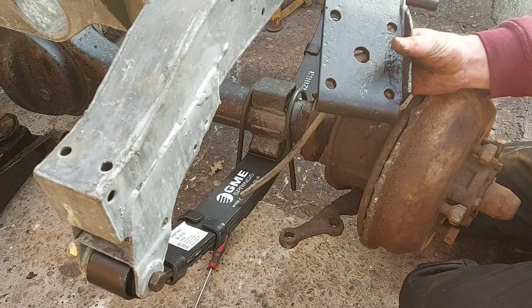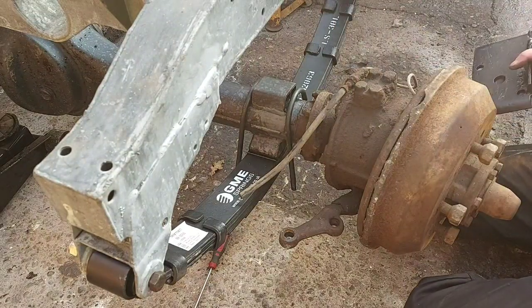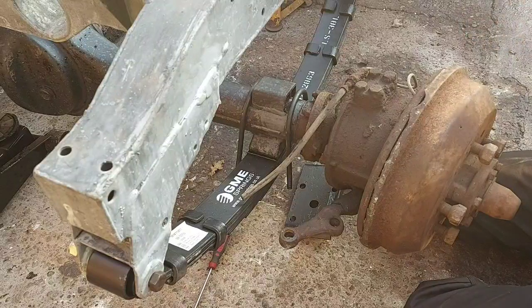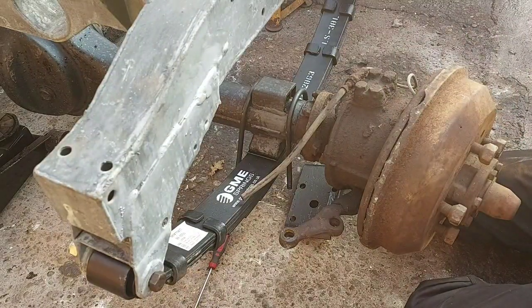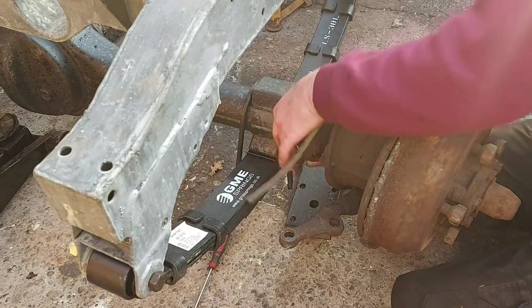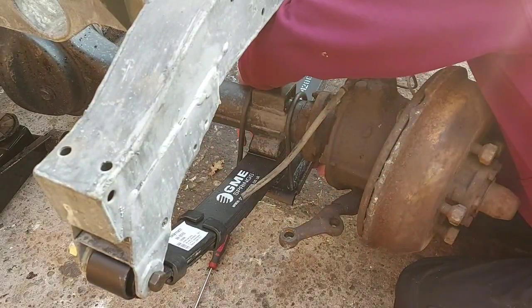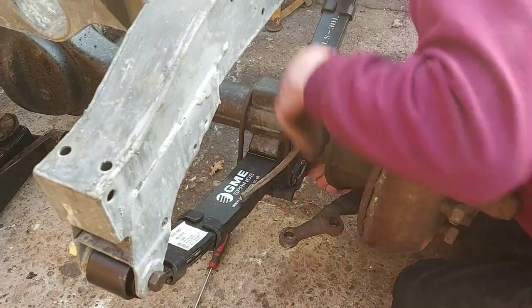Right, don't know if I mentioned it earlier, there's two different sizes of these, big ones at the front. They go underneath. Before I do, double check I'm not forgetting anything. Borrow that one off of there for now. U-bolt's just knocked over the top of the axle, just tap down slightly. And it might take a bit of coaxing into the holes.